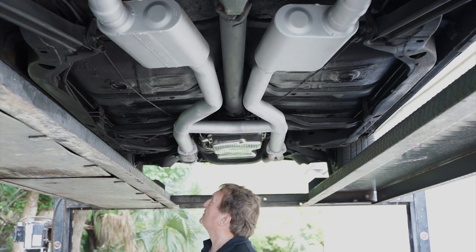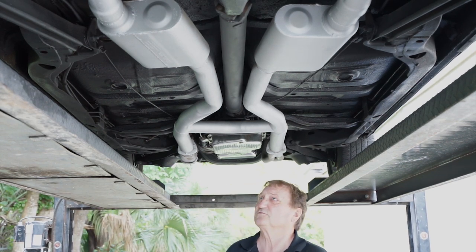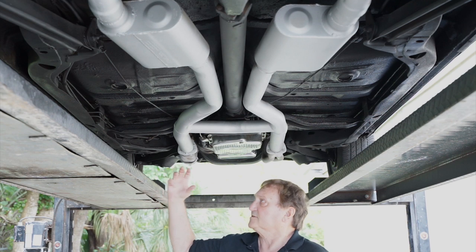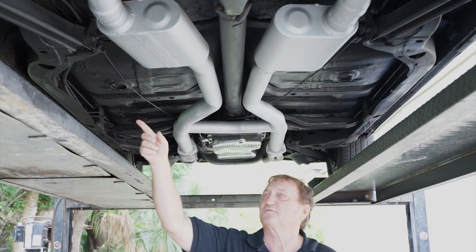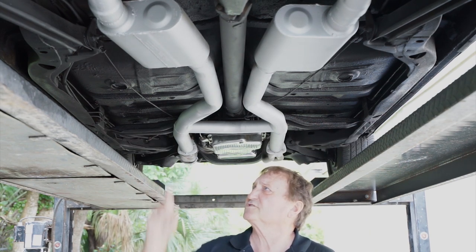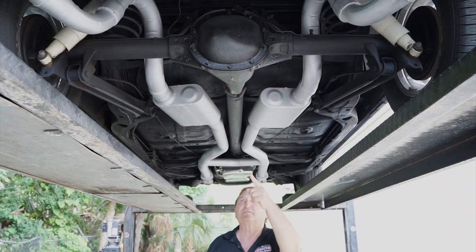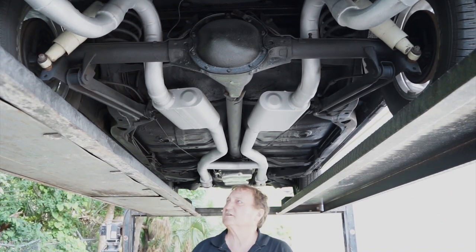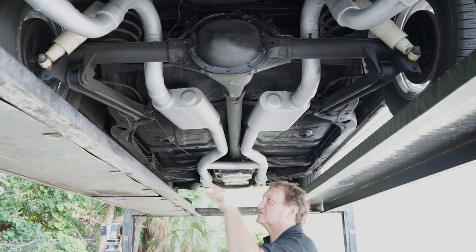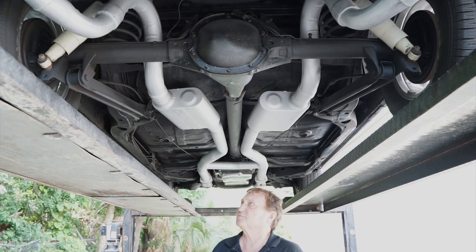The structural floor pan pieces are undented and unmolested — nobody jacked it up on those pieces through the years. The floor pans appear to be original. Fuel line has been replaced; original brake lines are still on the vehicle. A couple of small jack stand marks visible but nothing structural. Frame C-channel sections going into the back box frame — no jack marks. Bushings appear relatively new on the front swing arm assemblies. 10-bolt heavy-duty rear end as Pontiac used in these GTOs. Drum brakes front and rear — the heavy-duty Pontiac brake system.